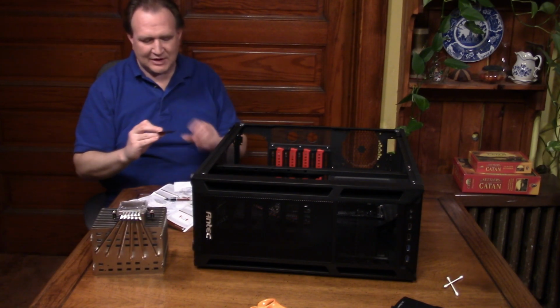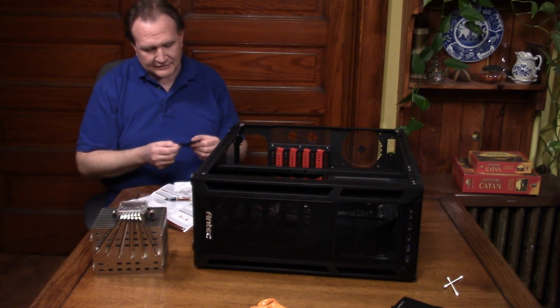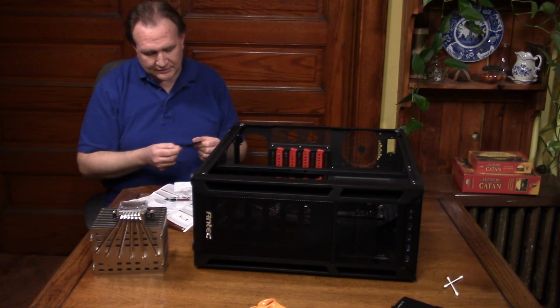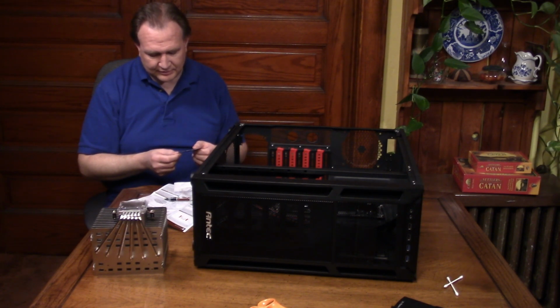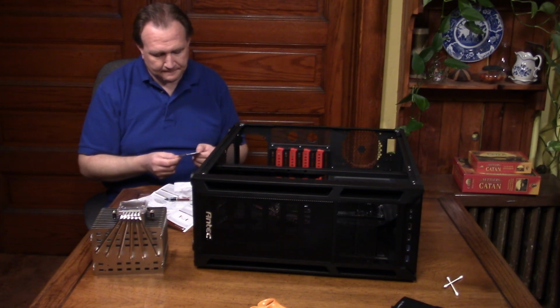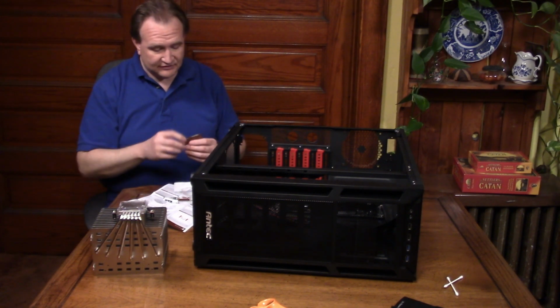Alright, they gave us this cleaning wipe. Should I use this? It was designed in Austria. Clean the CPU or the GPU with one side of the wipe, fold it in half, and use the other side to clean the contact surface of the heatsink. Discard wipe in domestic waste and wash your hands with soap. If slight residue remains after cleaning, you may use a dry paper towel or tissue to polish them off, but such residues are of visual concern only and will not impair performance. Why not? If I don't use it now, I'll just be saving it forever.